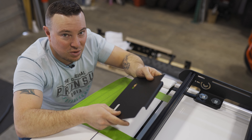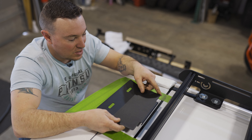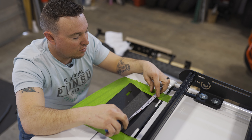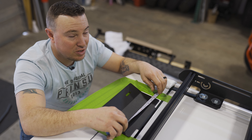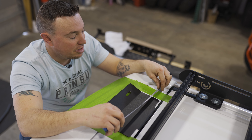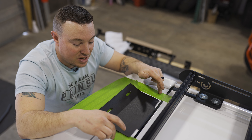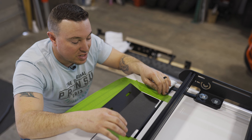Okay, so we're at the back of the vehicle. We have our top plate here. What we're gonna do is set this in place and kind of understand exactly where our ladder is gonna go. We'll set it down here and then we're gonna measure over four inches — that's where we're putting ours. We did engineer some tolerances; you have about an inch to either side that you can shift it around, but for the installation video we're going with four inches. We have our four-inch mark. I've applied this green tape, and this is solely just to protect the vehicle from scratches during the installation process.